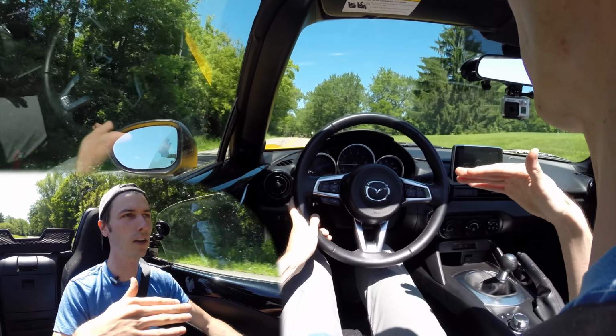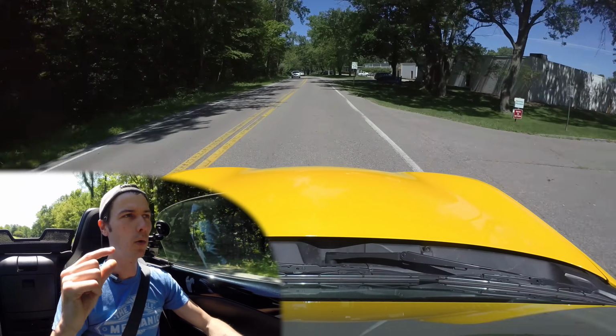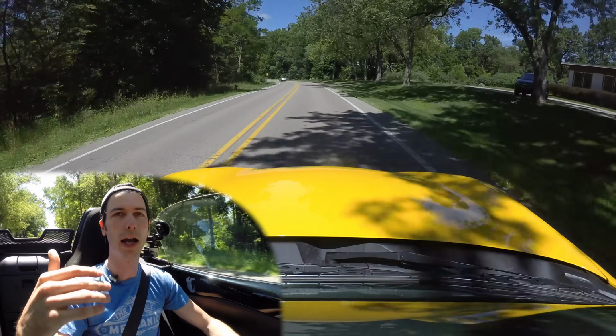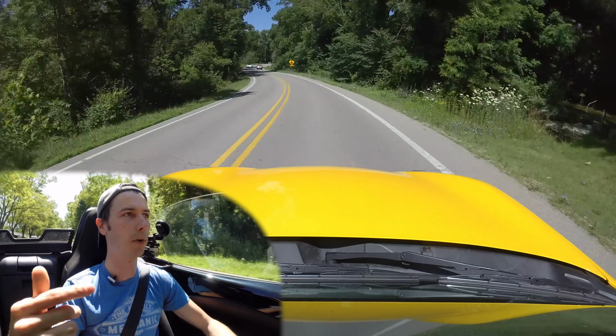It doesn't seem to be nearly as bad in any of the other gear shifts. And again, this is only with low throttle positions. If you're at wide open throttle or 60% throttle, you don't notice it. It's only when you're driving around the city and you're just puttering around, it has that bad rev hang from first to second.